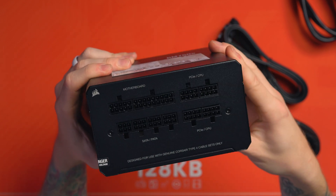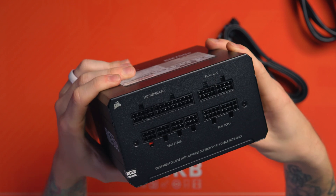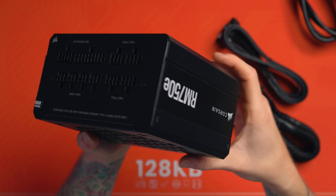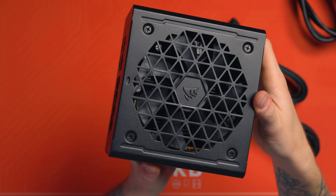The 750E is still classed as an ATX power supply. You can get SFX and all that, but I wanted to go the more affordable route. I've got the 750E and I'm hoping it's going to fit because this case has an ATX bracket at the front. I'm also hoping to mount the ADT-Link UT3G at the bottom somewhere and have the graphics card towards the base of the case.